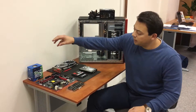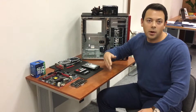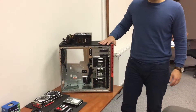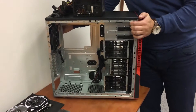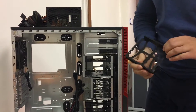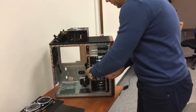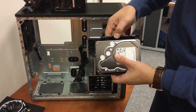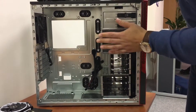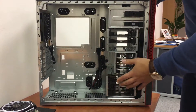We are going to use this great motherboard from Supermicro, chassis and some other components from third party companies. First, we can have a look at the Supermicro chassis, which is a really nice build — it's about 10 kilograms heavy and everything is just perfectly shaped and the materials are really good quality as well. This chassis is really quiet as well. You can see a really good tool-less system for hard drives. You can use six times a 3.5-inch hard drive, or four times 2.5-inch, or obviously all together.